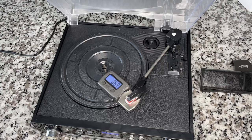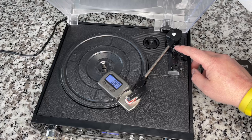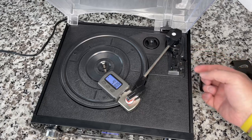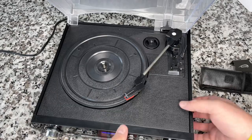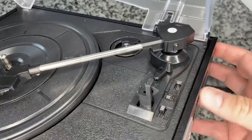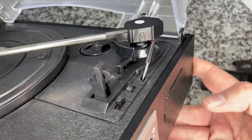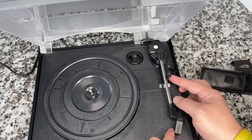The reading is about 0.7 grams plus five, so around 5.7 grams total — not as high as I feared, though the cueing lever wasn't fully lowered so it's more like six grams. Still not terrible; we've seen worse. A lot of people ask about record skipping — first thing is to push that cueing lever all the way down. This one has like nothing in terms of mechanism quality — it's cheap; it's an entry-level unit.